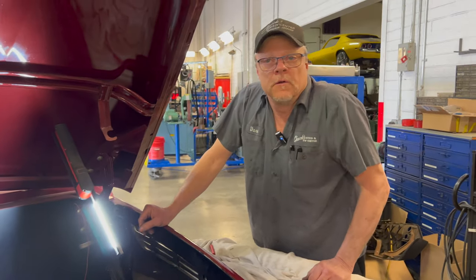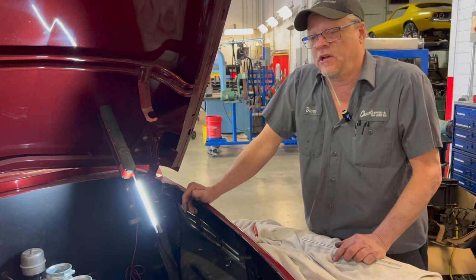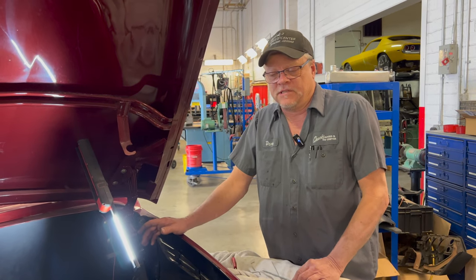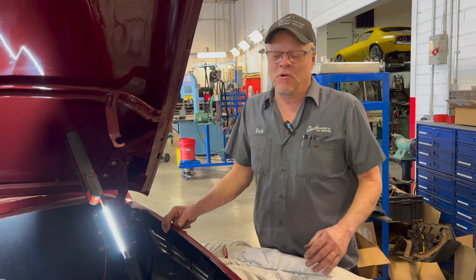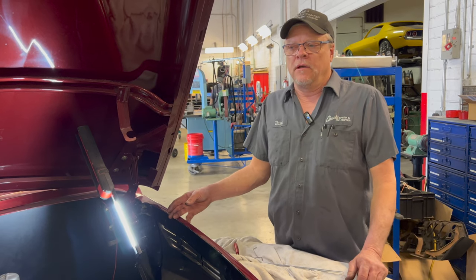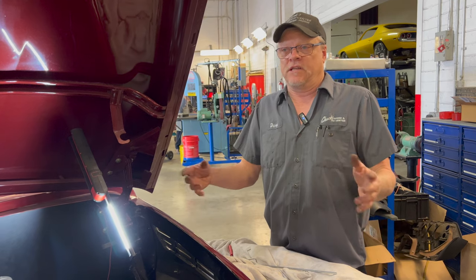Have you ever encountered three carburetors being kind of too much because there's three of them? Yeah. The more common thing is when people put 2-4 barrels on. They'll put a high-rise intake or a small blower on it, and then they'll put two 600 CFM carburetors on it, and at wide open throttle you've got 1200 CFM. Most motors don't need that. So you'll find a car that's fouling out the spark plugs all the time, doesn't want to restart when it's hot. Very common. It's a much happier engine if you're in the 350 to 500 CFM range per carburetor at the most, as opposed to 600s or 750s.